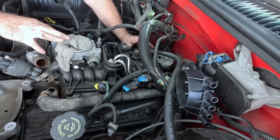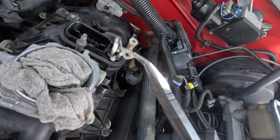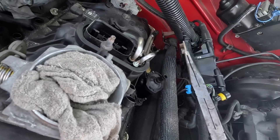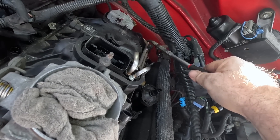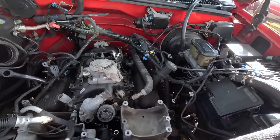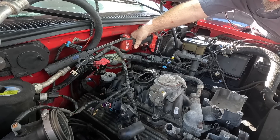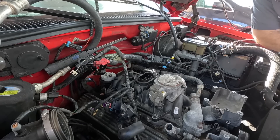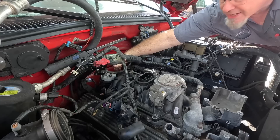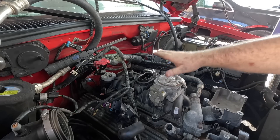Let me get my yellow marker and needle nose to get that clamp off for the vacuum hose. See that ridge? That face is down — all those little ridges do is hold down on the lines. There's also a 10mm back here holding that bracket to the manifold. There's enough play that I can pull them out of here. I just want to see if there's any residual fuel pressure. There are fittings back here to separate the bracket from the main fuel lines but they're a big pain, and if you disturb them you've got to change the O-rings. So we're not going to disturb them — I'll just tweak the bracket up and pull the manifold out from under it.